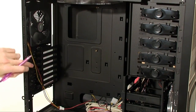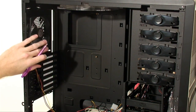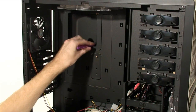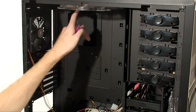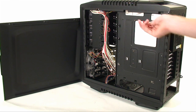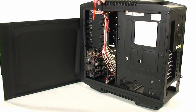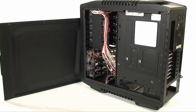At the back there's a horizontal PCI Express slot with clips to run wires, a 120 millimeter exhaust fan, and the CPU backplate opening. At the top there's a 200 millimeter LED exhaust fan. Spacing for wiring and a CPU cooler backplate opening are also included. The drive bays are all inset to allow for more cable storage, and the back panel is not flat — most of it has been pushed out, giving you a lot of room to run wires.